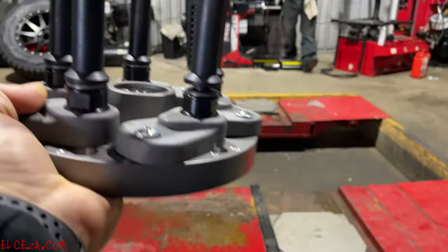If it's a little over, it's going to come down and touch the back side. Won't work. The reason it won't work is the same reason I know everybody liked the old pyramid style collets, the old conical shaped ones. Everybody loved those, right? The problem with those is they would bottom out in the inside of that rim bore. So you have the bore itself and then the face plate of the inside of the bore. They would bottom out against that face, therefore allowing the rim to do this while it's spun, because the collet was bottomed out on the inside. These won't bottom out, okay? They stay inside that rim bore, okay?